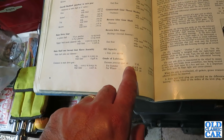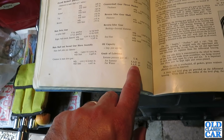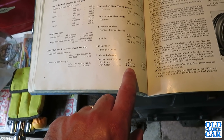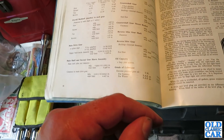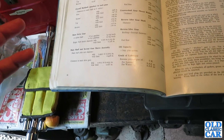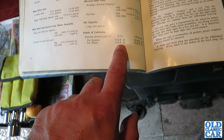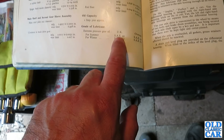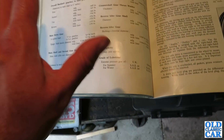It says extreme pressure gear oil SAE 90. But I know in some old gearboxes they don't like having EP 90 due to some of the additives in there — the yellow metal parts within the gearbox don't approve of EP rated oils. I don't know what's in there, so I'm going to make sure it has SAE 90, the straight 90 gear oil. That way I know it's the right stuff.